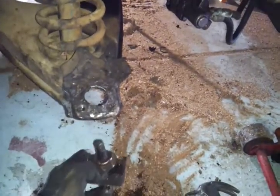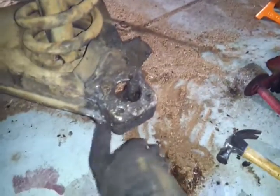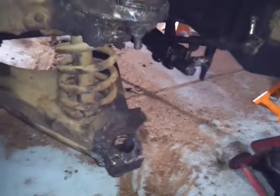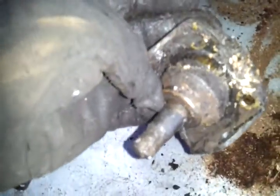As well as the lower ball joint — it's held in place by six bolts. You've got two coming from the inside out, and then four from the bottom up. Trying to get the ball joint to come down is kind of a pain, because the bolts are coming out of the lower control arm and it's held in place. There's no room underneath unless you can get that seal off, which is kind of a pain.